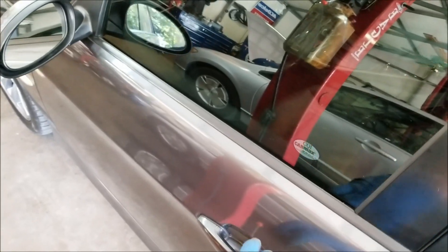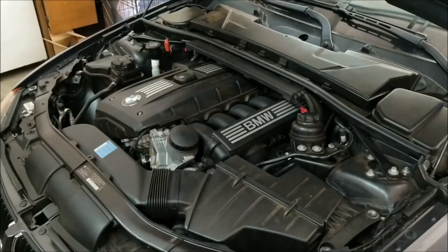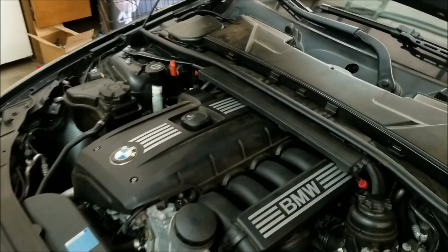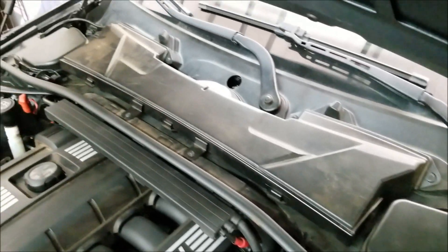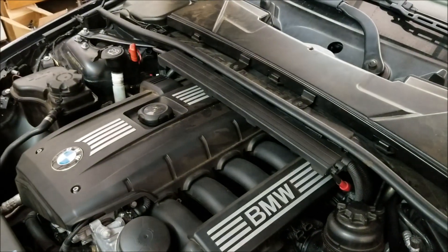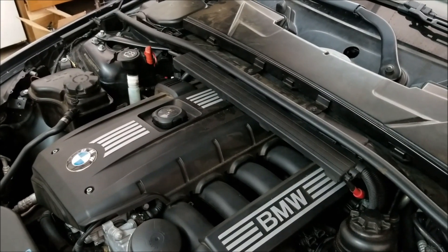The first step is opening the hood. Only about three quarters of the top of the engine is visible. The rest of it is held behind this rain tray and air filter tray for the inside air conditioning. We must remove this tray in order to gain access to the top of the engine, the cover, the coil packs, and thus the spark plugs.